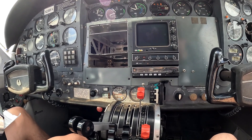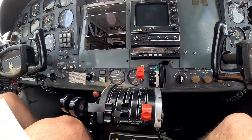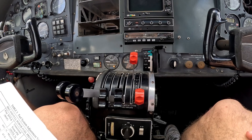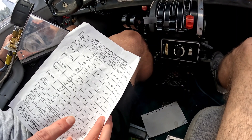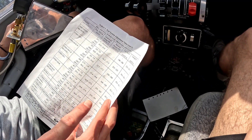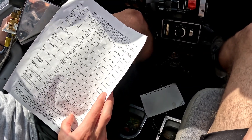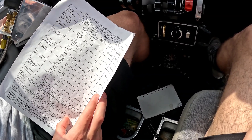So you set your idle RPM, you set your high RPM, your metered fuel pressure looks good on the ground — is there something else you do? Yeah, you check your mixture cut-off on shutdown. That would be done in the first few runs. Then the last step: take a look at this chart — your fuel flow in pounds per hour. That's not checked on the ground. You're going to do a 15-minute flight and identify the fuel flow per Note 5, and make sure the airplane is doing 250 pounds per side in flight. That's the last check for the pressure pump.